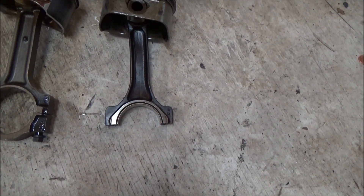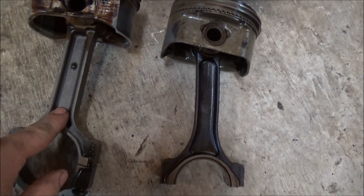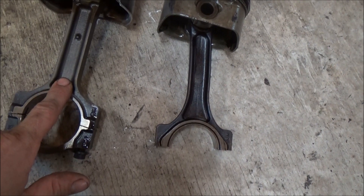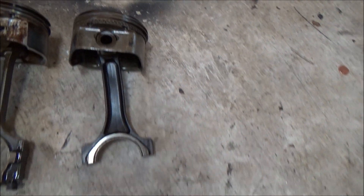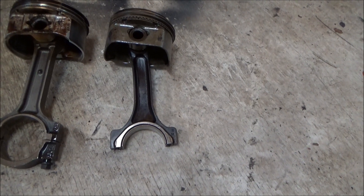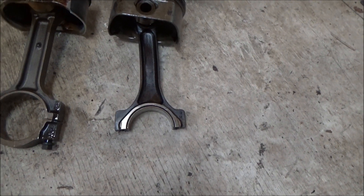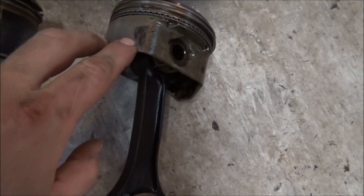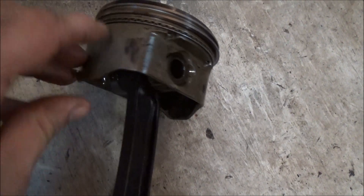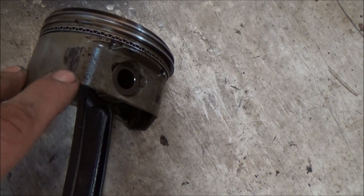In terms of strength difference, these are a lot stronger and can handle quite a bit more horsepower. I've pushed the I-beam style rods to pretty high horsepower, and it all depends on which way they bend — they always will bend, but they may not bend in such a way to give you a problem. This one happened to give me a little problem — there was a rubbing issue because the piston got cocked sideways, and that was making a tapping sound.